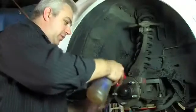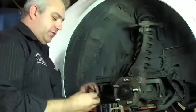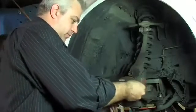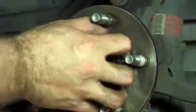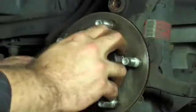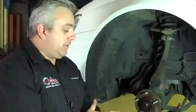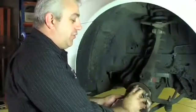Once again we'll just spray a little bit more of our WD-40. We use some fine grained emery paper and we work our way around the spigot. It's very important that we get this spigot area clean because if there's a build up of rust scale on this spigot it can cause the disc, when you first fit it up, to actually sit away from the hub face. When you actually push it on, it tries to flare the hole out. If we don't clean this spigot area properly it actually tries to bend the disc and bow the hole out so that it will fit on. This naturally puts notable stress through that hat area of the disc which results in often cracks through the centre hole.